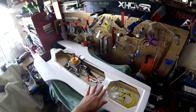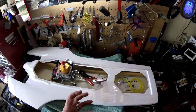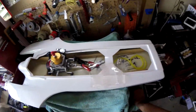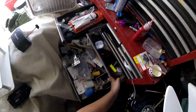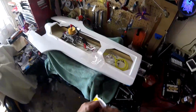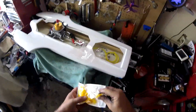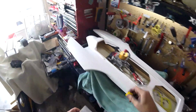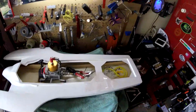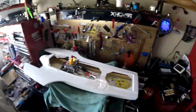The nice thing is you can fit them in small places. They're much lighter, much cheaper, much easier maintenance. You can even pop it out and take it out if you want, just for whatever reason. It keeps your fuel from foaming when you're going back and forth. The only drawback, if there is one, is you have to use a fuel pump, like a crank pump or an electric pump. You can't just pour gas into it. But I used pumps on all my other stuff anyway.